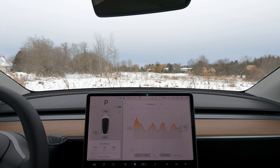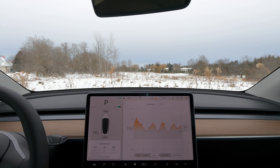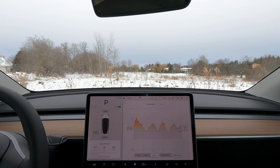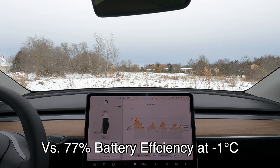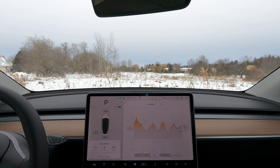Let's unpack this trip. We ended up at 234 watt-hours per kilometer and we did 51.1 kilometers, right in the range of the previous test. We ended up at 195 watt-hours per kilometer according to the vehicle on the minus 1 degree Celsius test. So rough math is that we've used about 15% or so more energy. In terms of my reflections on the trip, the temperature was very comfortable — in fact it was getting a little too warm — but I kept everything as is just for the sake of this test.